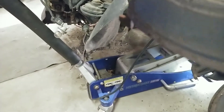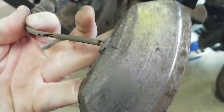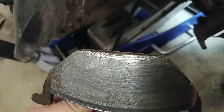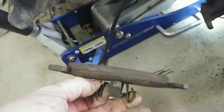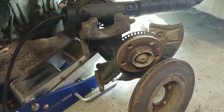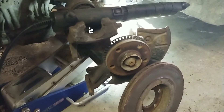These are the sensors that are included in the brake pads. That one right there is worn through, and I'm pretty sure that's why it says the brakes are bad. You don't see the center groove — that means they're getting worn. I think somebody replaced one side at a time — two different kinds of brake pads. I hate when people do that. You gotta do what you got time and budget for, but go back in the next few weeks and do it right.